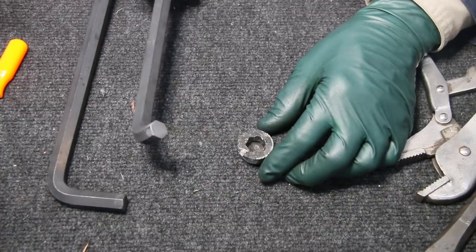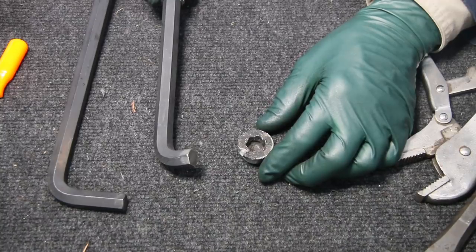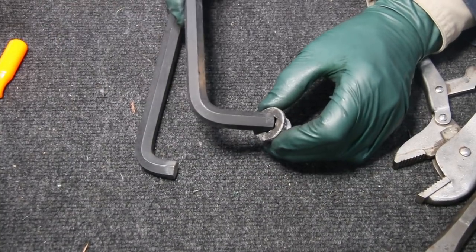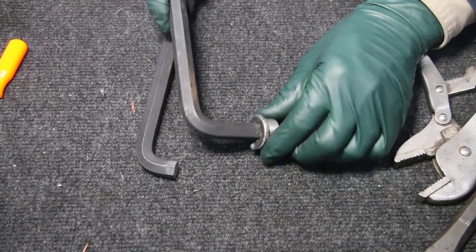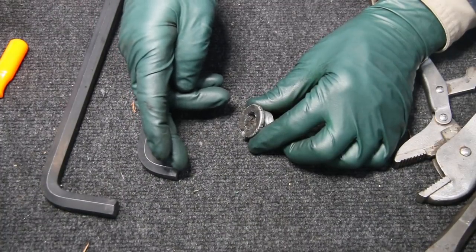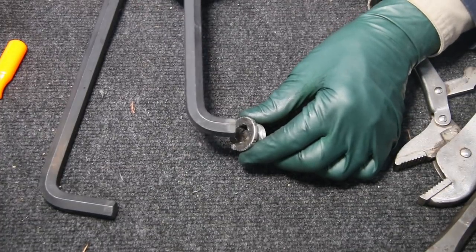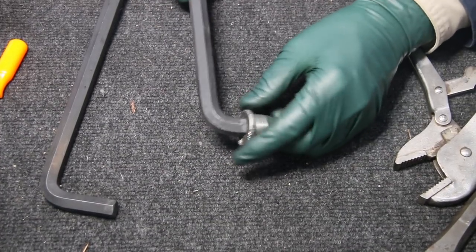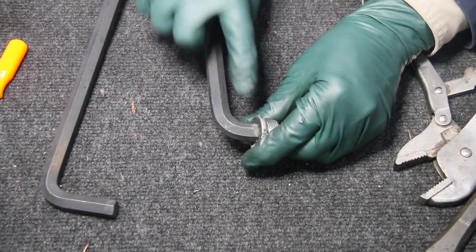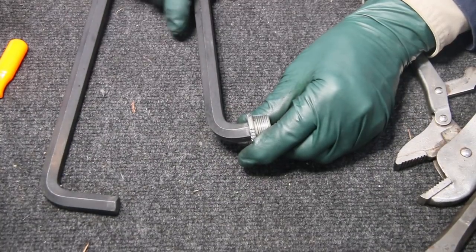As I explained in the other video on hex plugs, that's the reason I developed this special 14-millimeter wrench to remove plugs on Mercedes rear ends — both for filling and draining — and also the plug on a lot of manual transmissions. The problem with this one is it has a long head, so when you torque on it, it tends to want to twist out. So I cut it off and put a rubber handle on it because sometimes you really have to torque on these. Now when you get it into the hex plug — and I may hammer it in — I'm torquing closer to the center of rotation, which prevents it from rolling out under heavy torque.